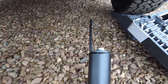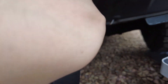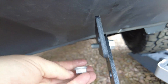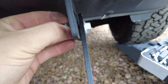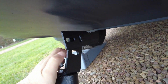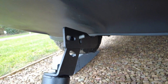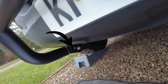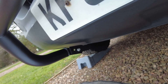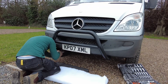So once you've got these brackets on either side, the best way to actually fit it is to lift it up to the first hole, pop the bolt through, screw that first one on just slightly so you can use it like pretty much like a hinge. Move to the opposite side, line that up, pop your bolt through, and screw it over on this side with a nut. Lift your bull bar up — it lines up to the next bracket, put that next screw in, then tighten the brackets up and tighten everything up.